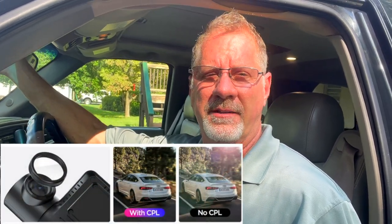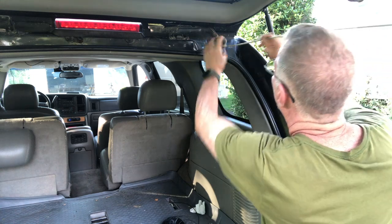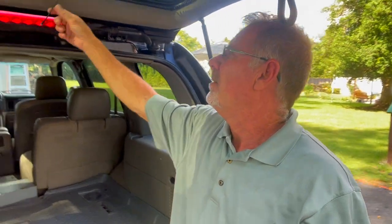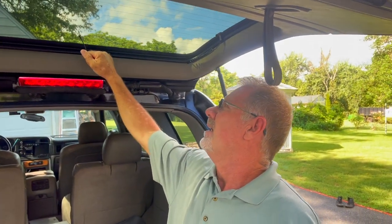It also comes with a polarizing lens that you put over it to knock the glare down so you can get those license plates and see what's going on with good picture quality. You just pop that right over the lens and this one's got it going. The wiring to the back camera — the back camera's not wireless. I just put mine through the headliner. Now the little connectors are fragile, so you do want to be careful. When you're putting this back camera on, you want to make sure that you don't run the wire in a way that there isn't enough slack. See how I ran the wire in nice and clean, and I gave myself enough wire to go to the camera.